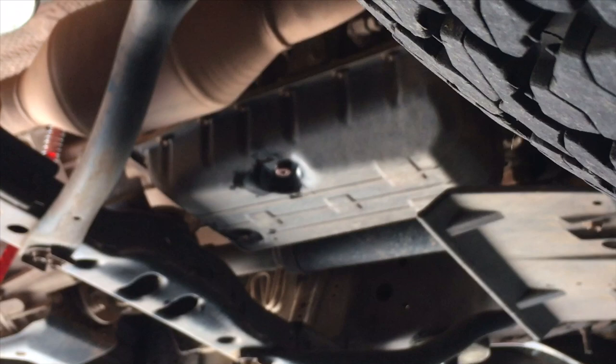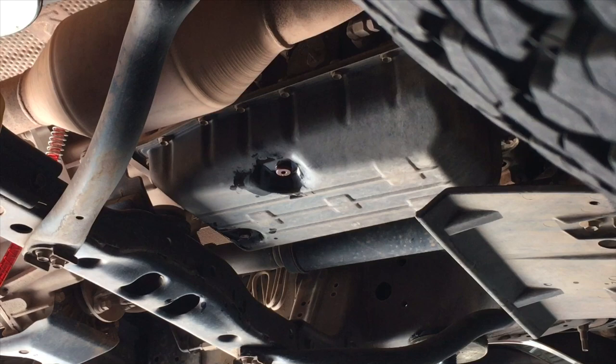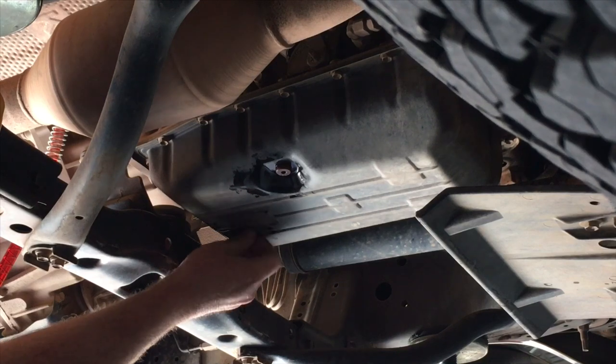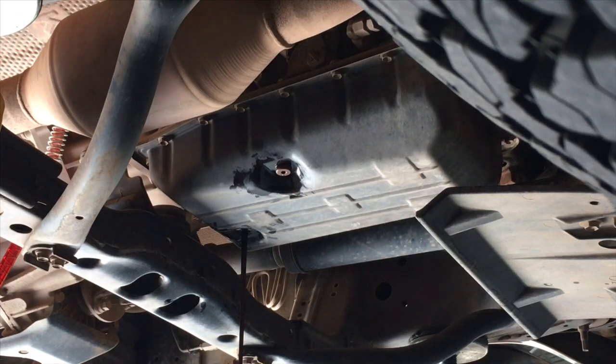We've got the assistant circulating all the transmission oil until it hits approximately 40 degrees. Hey Johnny, chuck it in park and switch it off please. We're going to drop that oil out again. So what we've done: dropped every bit we could get out, put some more in. We're still watching the colour — at the moment it's still brown. We just keep this process going until we see more red coming through.